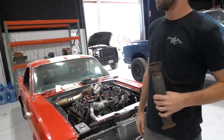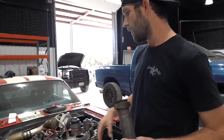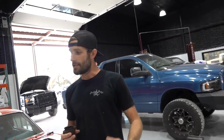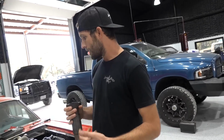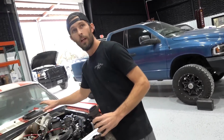He's like, man, what's going on? We're like, dude, we can't get it to run and we can't figure out really why. We've tested a lot of things and we're fixing to get to the point where we start tearing the motor down. Y'all found a few things that were wrong, but nothing that would stop it from running. Exactly, yeah. We found little odds and ends and took care of all that stuff, and we were making plenty of ICP, high pressure oil. We were making plenty of low pressure oil. They honed out one of the cylinders.